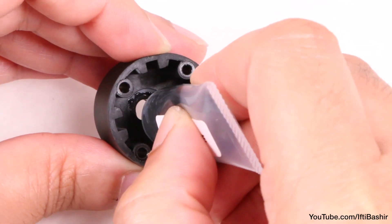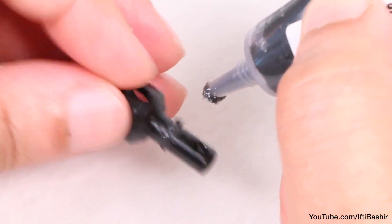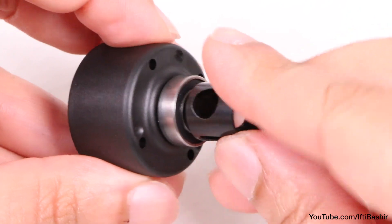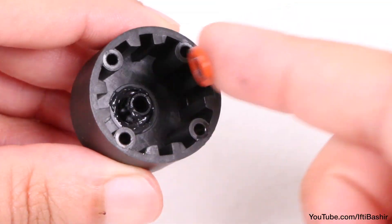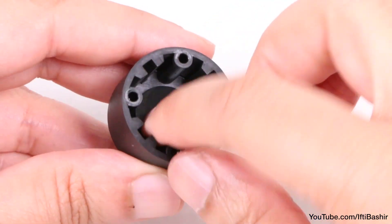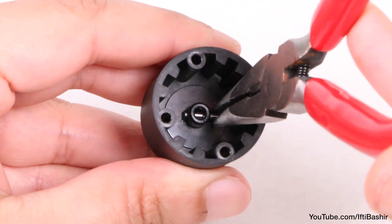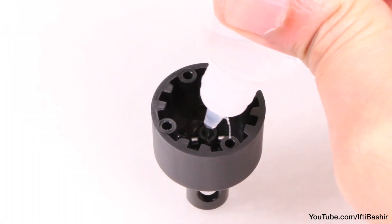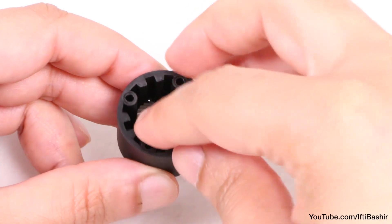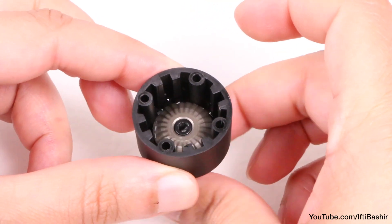Cracking on, let's grease the recess within the cup and the outdrive groove, before inserting the bearing and the outdrive into the cup. On with the greased o-ring, the shim, and the outdrive pin with some needle nose pliers to help. A couple of drops of oil to cover the bottom comes next, after which we drop in the first gear, making sure it's seated on the pin by giving the outdrive a little turn.